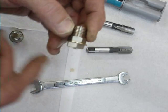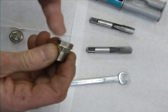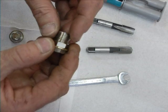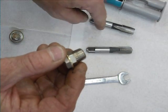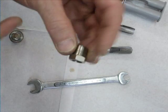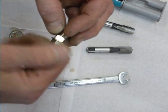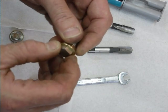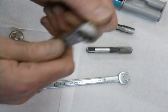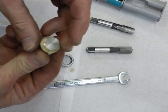I hope this has been helpful for other motorcycle owners. You can find other videos on YouTube for different fixes, but this fix is for when you want to be able to screw in and out constantly. I could have just left the new quarter-inch aluminium thread I cut and put in a new bolt, but over time that would be compromised. You do not need to go red in the face tightening this drain plug — it's a 14 millimetre, just a little nip up and that's enough. Thanks for watching.